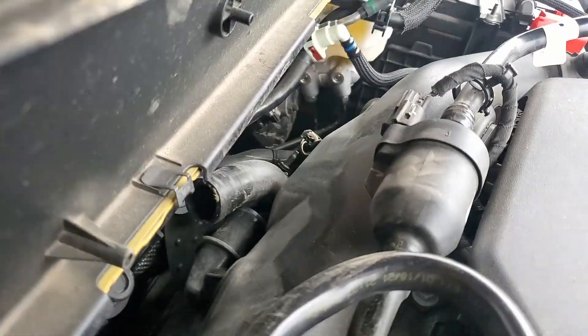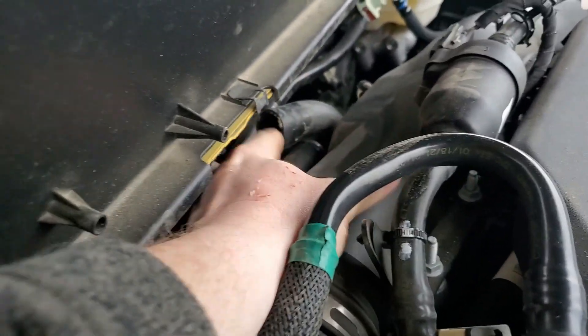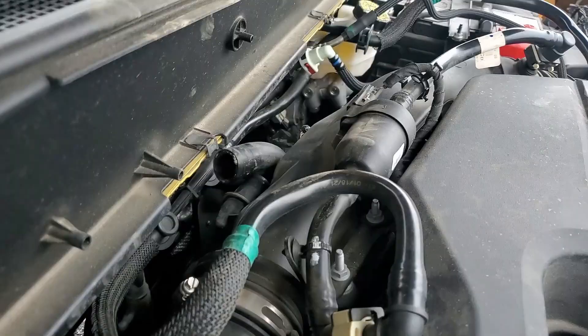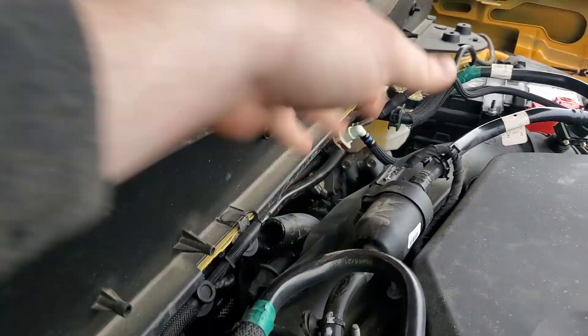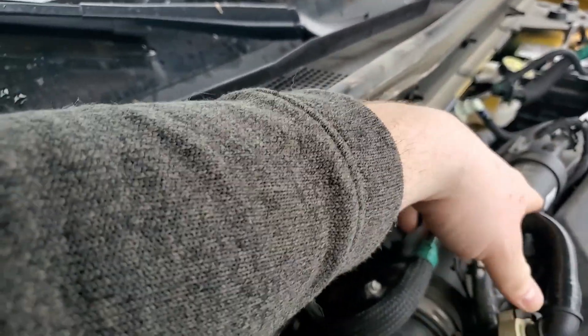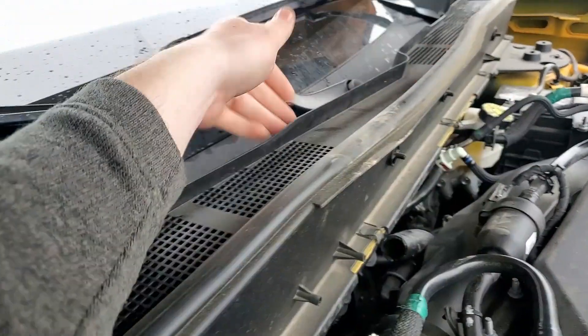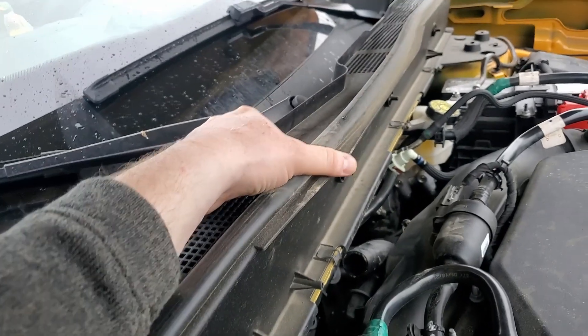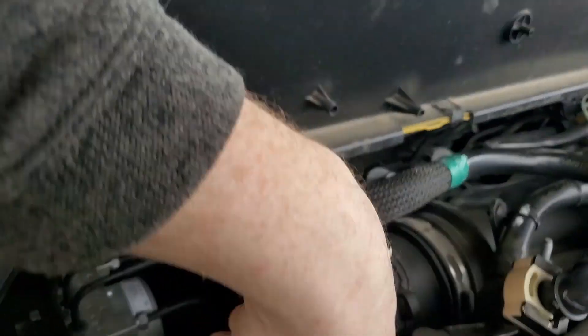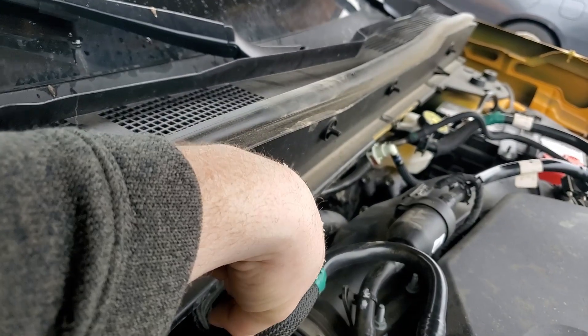We'll pop that cap on right here so we can return the ones we didn't need. The hose we took off is right here — we need to cap this back off. This is your bypass return; it goes back into your intake. Right now all that sound is coming out of here. If you wanted to, you could put an extension on it, run it out the side or out the hood — people do that in other vehicles to make the sound much louder once it's out of the engine bay, since there's sound deadening up here.